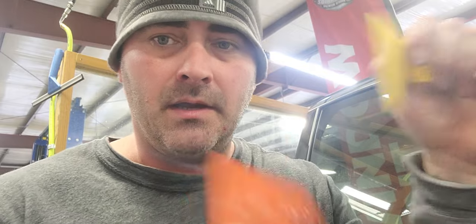This is what I use for bottom loading. I'll use the easy tip from Expel — it's a great tool — and I'll use this to shove into the gasket from the bottom of these doors, pop it back so I can slide that bottom loading tool in. I stole that one from Rick Tallman, appreciate it — handy little tool. And this orange crush, I just cut it down to make it a little smaller — works great for squeezing out small quarter glasses.